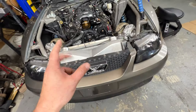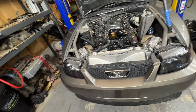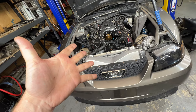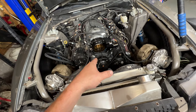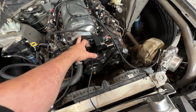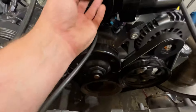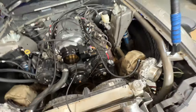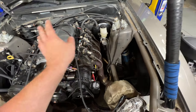This is a 0648 with a Summit camshaft - if you want the particulars I can put them in the description after you remind me 16 times. This is the Summit intake, Summit cam, and a Snake Eater 102 throttle body, because I've never been able to use this 102 - I've always had 96mm openings and it would hit. But yeah, this one is a whole 102 in there. Turbos are on. I'm going to make bumper exits - I'm tired of the undercar exhaust. This one sounds way better.